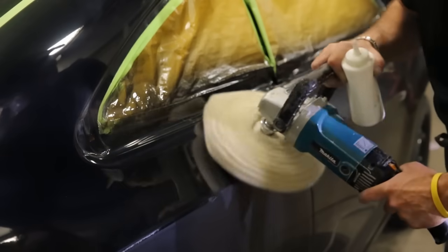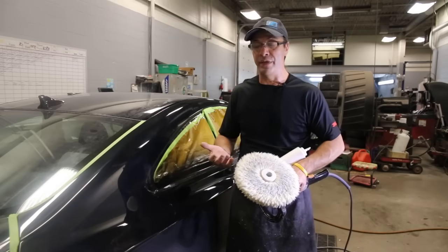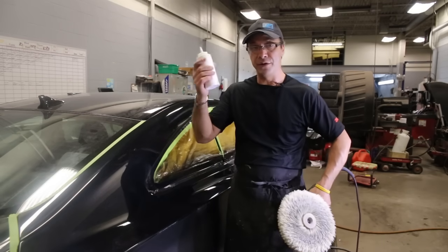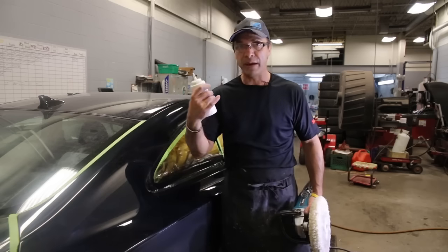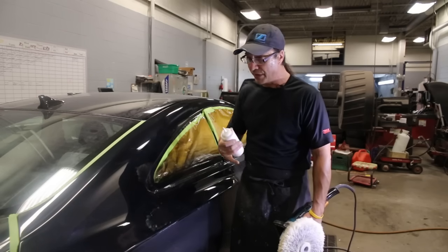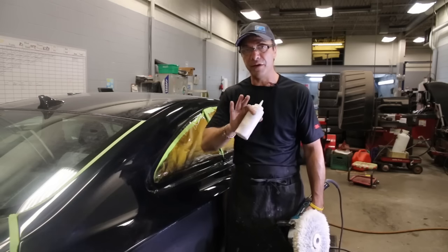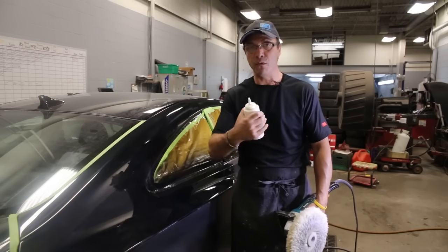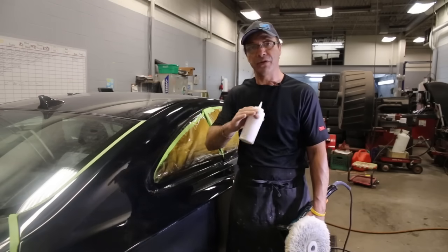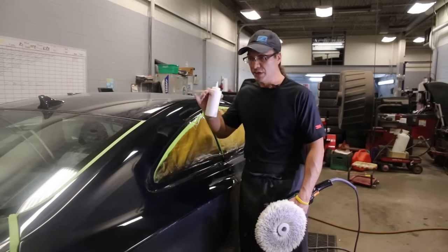I've basically done this whole car with a DA. Back in the day, if you wet sanded everything, even doing a show car, you had to finish that surface with 3000 and above so you don't see any of those sand scratches. To the normal naked eye, the guy walking down the street doesn't see it, but you and I being professionals, we know what to look for. With this system, by the time you're done you see absolutely no sand scratches whatsoever, because the 3000 wet went right over the 1500 scratches and totally took them out. On this black metallic you can't see not one single scratch mark.